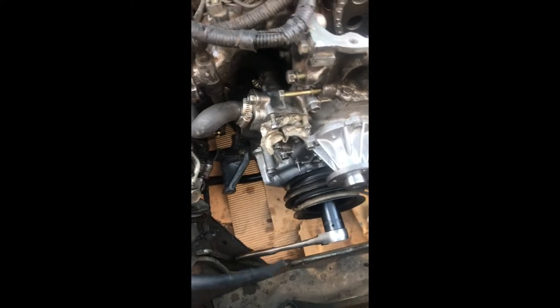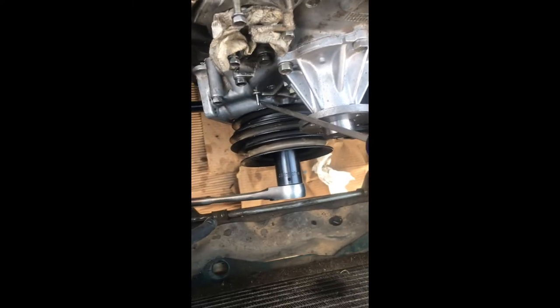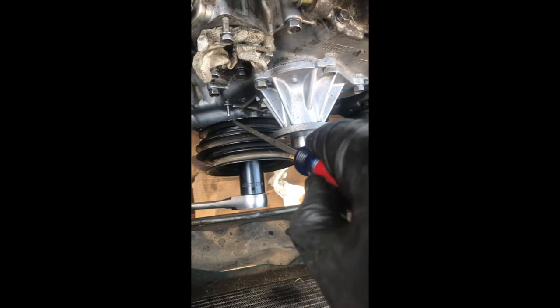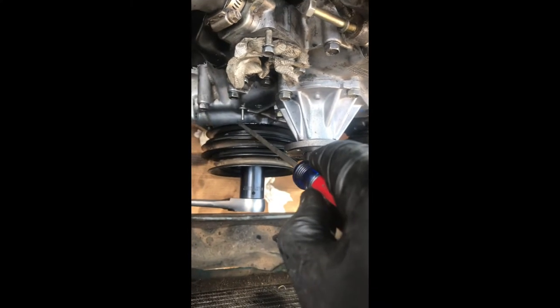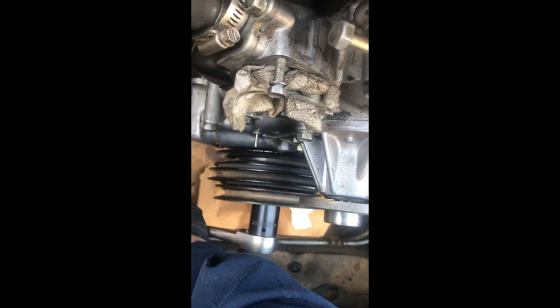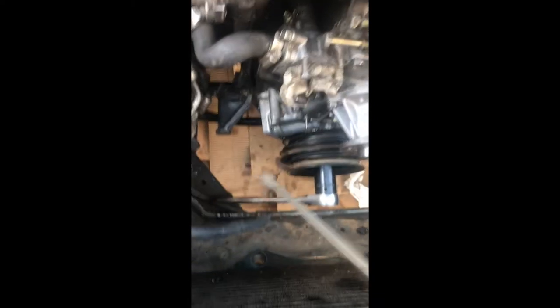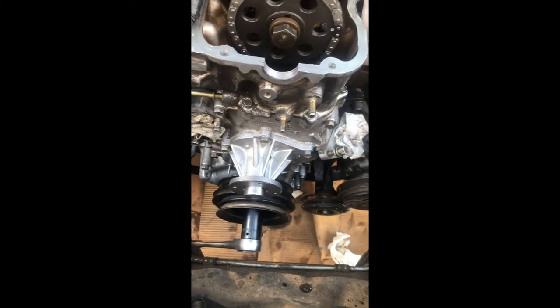I tightened it — actually decided to go with 108 foot-pound. I want to align this pointer here with zero. This is minus 5, and the second one is zero — I'm a little bit out, so I backed it up slightly and it looks good to me. I'll know for sure when I put the oil pump and see if the rotor faces number one. If that's the case, then we're all set.